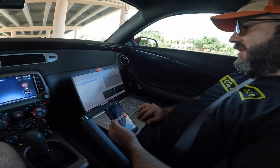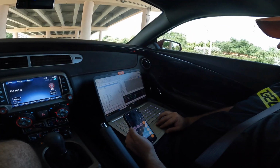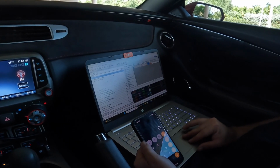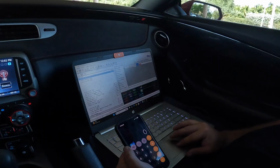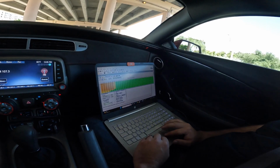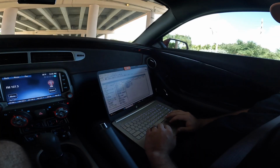So it started to lean a little bit. It was there after like 5,500 RPM. It was like 2% lean, and then it got to the 4s, and then really up top the reading got like 10% lean. No, you have the stock values for the no lift shifting.